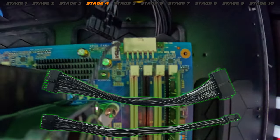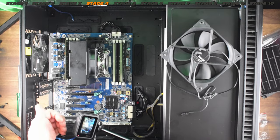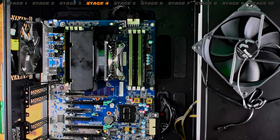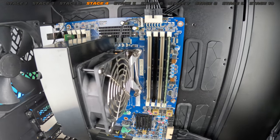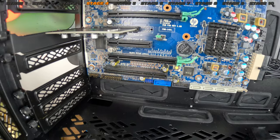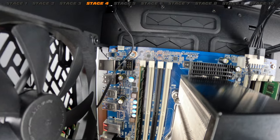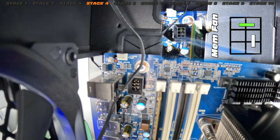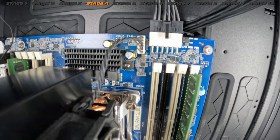Once it's in, it's an absolute breeze. I'm unplugging everything because I actually did a test fit of the Z840 motherboard right after — but that's a future video. The motherboard is mounted, we've got RAM, a CPU, potentially power, and we've done the IO connections. There's that memory connection — definitely take note of that one. If you're running more than four DIMM modules you will have to deal with it; you'll need to splice some pins together to make that issue go away.